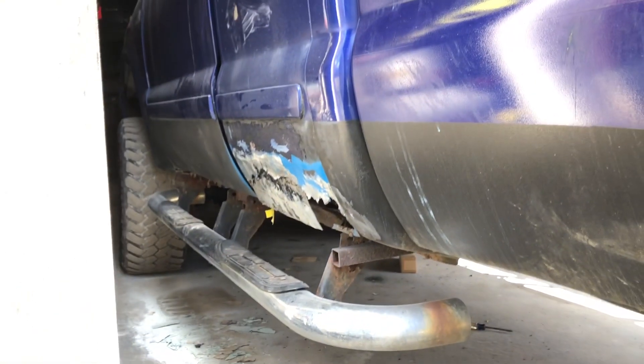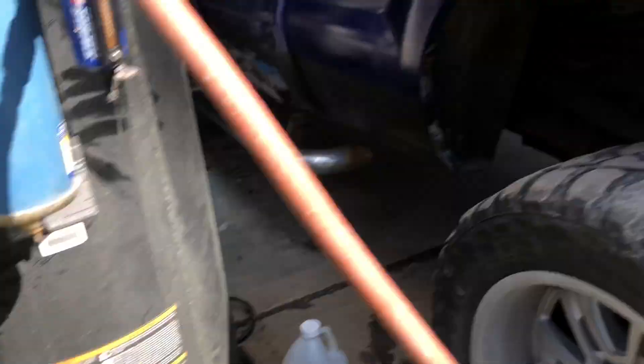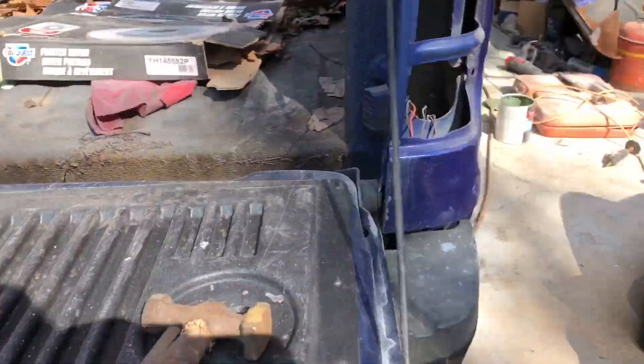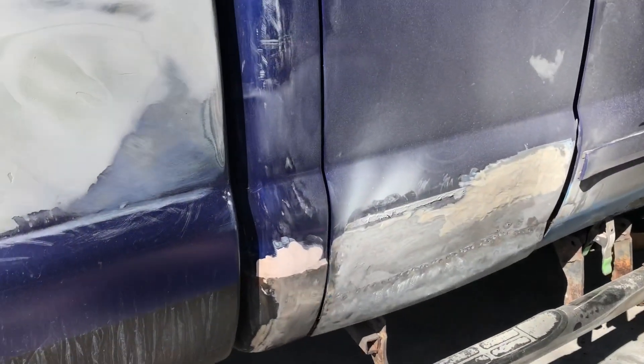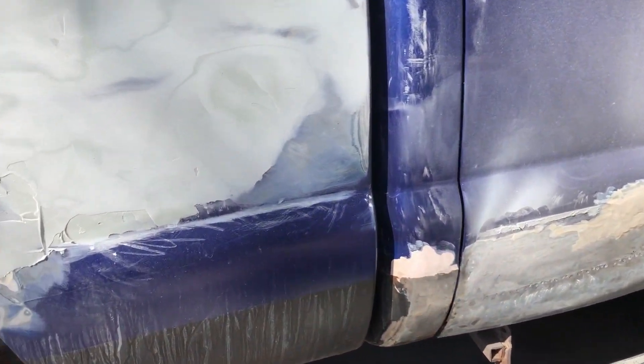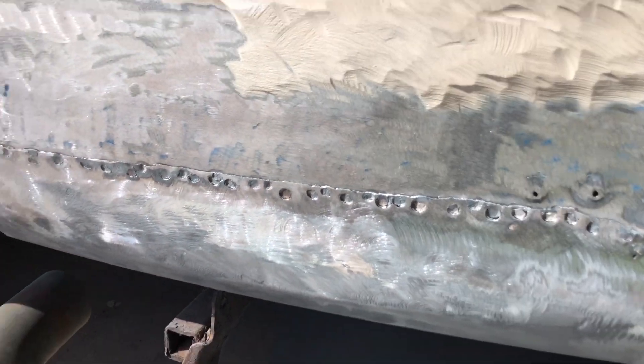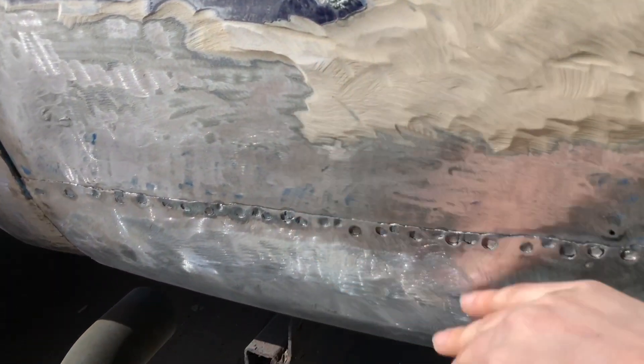On the other side I got that piece also glued in for the back door. I don't have much space to get over there — I'll get more clipped later. I also filled this hole here, which I'm about to finish — this arch today. Right now I'm focusing on the other side, I'm gonna get the Bondo on there and let it all dry, because then I've gotta run to the parts store. I'm just gonna mix up my Bondo and get this piece all cooked up, get some Bondo on this, make it partly filled in for now, then let that dry and move to the other side. It's about to take a ton of Bondo.